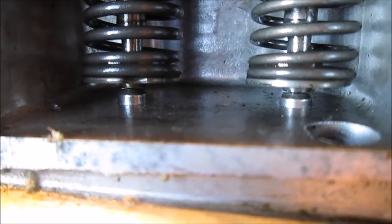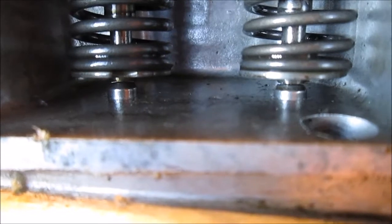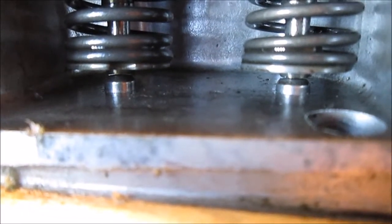Hello, YouTube. We're going to do the valves on this engine. On the exhaust, it's supposed to be 6 and 10, with the middle in-between. So if you pick the number in-between off the chart, you'll get exhaust 10, intake 6.